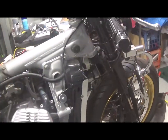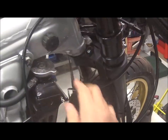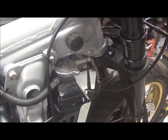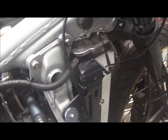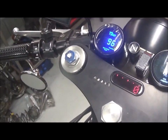As you can hear, the fan has kicked in as it turns off. That's the autopilot switch — I've also got the override switch right there, but it came on its own. The radiator's hot, which means the thermostat opened, and it's running very nicely. The temperature is currently 96 degrees.